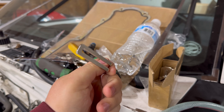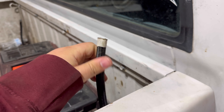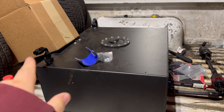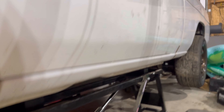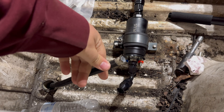You can see the return line running down the backside of the block, drops under through the fender, and actually runs along the frame and back up through the bed. This is a 10-foot section — it's usually what they sell — and it was not long enough to make it to the return, so we've got more ordered. Once that's here, we'll throw some fittings on and run it back. Feed line is pretty similar — comes down through the fender, runs down the frame, and comes up over. Should have enough to make that work.